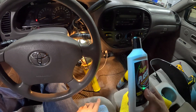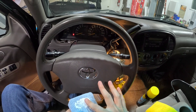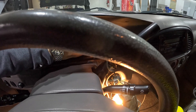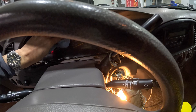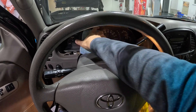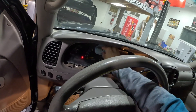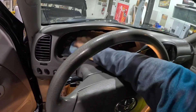What we'll do is come in and take a clean microfiber applicator. We'll take a good amount of product because we're starting from a dry pad. We'll kind of work it into the pad just so we're working from a good workspace. Just come in and give this a good quick scrub down from stem to stern. The nice thing is you can go edge to edge on this right now — you're not fighting with that cluster surround that you're never going to be able to fully work through. We're just going to come through with moderate pressure and work this product until it just starts to feel a little grabby, kind of starts to dry a little bit, and feels really thoroughly worked in.